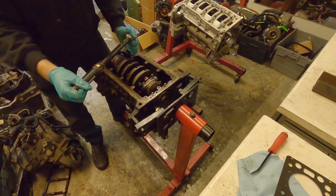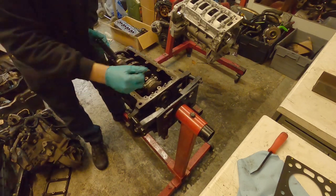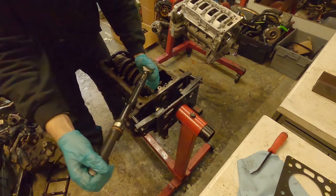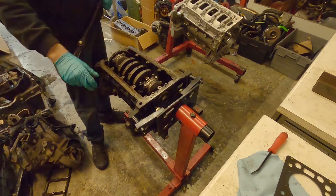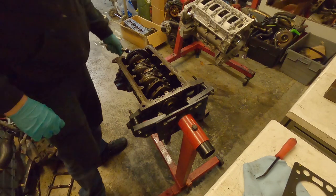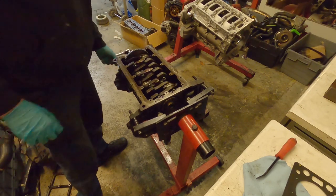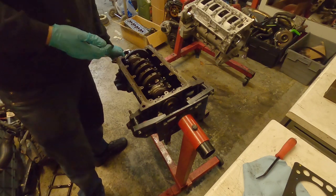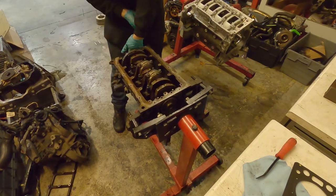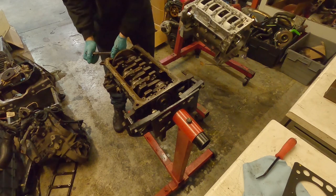You can spiral around them all over again just to make sure you definitely didn't miss one. It's quite useful with an angle gauge — if you move it, you can't quickly check it again because you don't know how far you've moved it. Using the Tipp-X trick is a good way of double checking, because you can visually see if all the Tipp-X has moved in the same direction. With everything torqued down, we're just going to check our engine for smoothness — it should be nice and easy to turn over with no resistance, no binding, no points where you have to push hard. It should just be smooth, repeated movements.